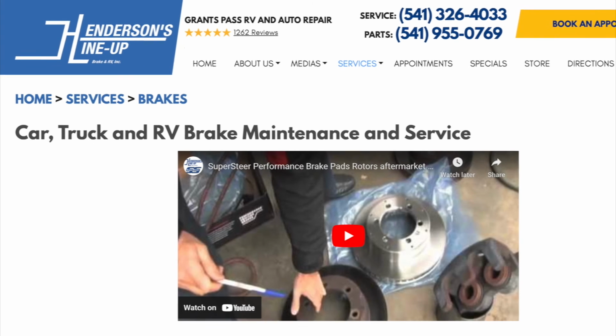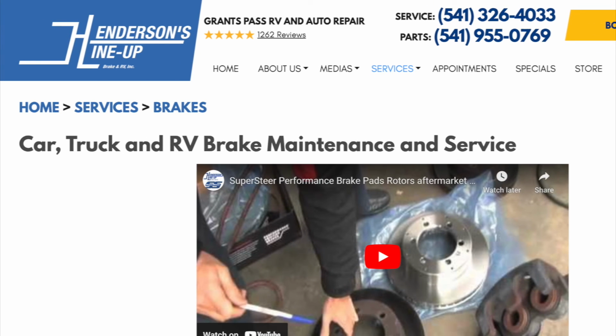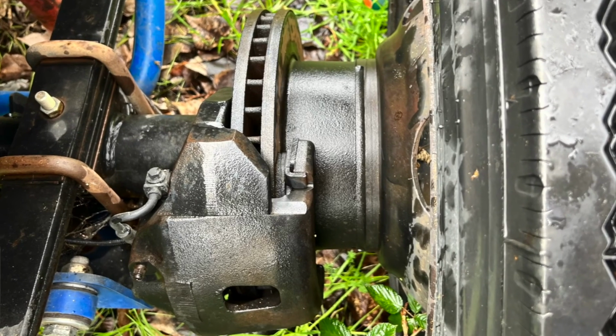Okay. Well, Dad, that was a great summary of the common steering and handling issues on the P30 and P32 chassis. Yeah, we didn't even get into the brakes. Basic maintenance takes care of many of the issues on these, but there's some upgrades available there as well with better rotors and friction material. That's right. All those coaches tend to have pretty spongy brakes even when they're functioning correctly, but it doesn't help when your caliper slides are frozen up.